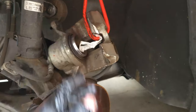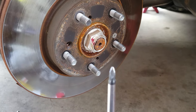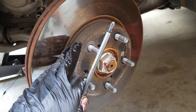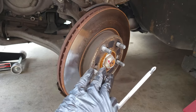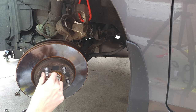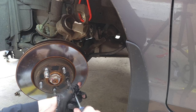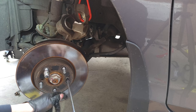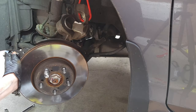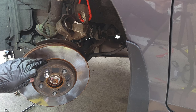Here on this rotor screw I'm using the Phillips head to loosen it. It could be seized, so be careful that it doesn't fall on you since it's angled down slightly. With one hand hold it up; you can also use a wheel lug just to keep it from falling. Save this screw and reattach it to the new rotor. Next we're taking the rotor off — it's not seized, which is good. We're in Southern California, so not much salt. These are about 10 to 15 pounds, so handle with care.